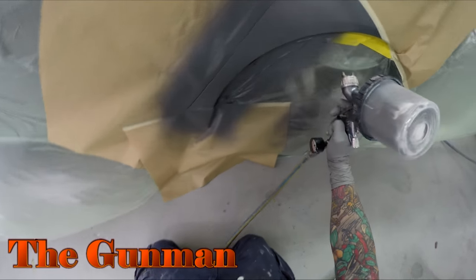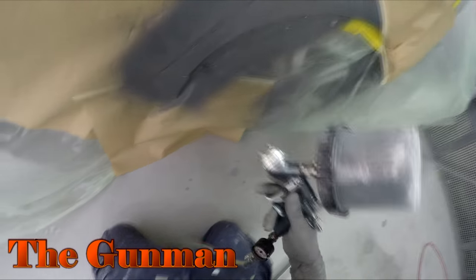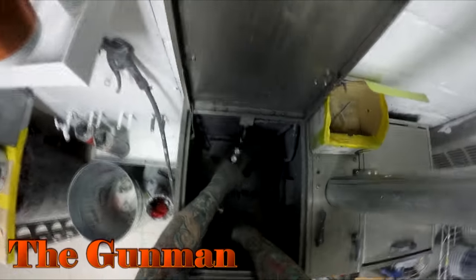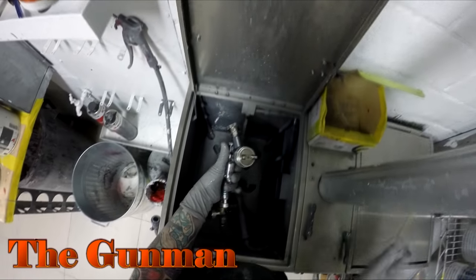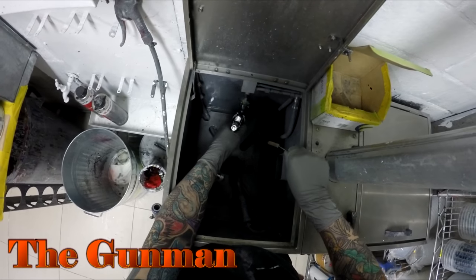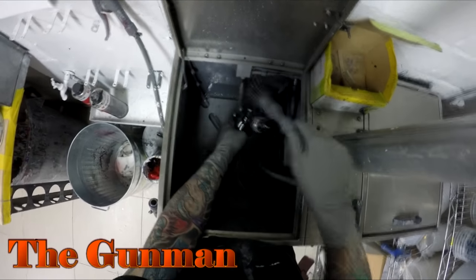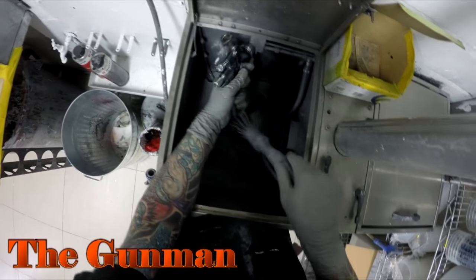For this job I ended up putting four coats on, obviously removing the flash-off times from the footage. You may have also noticed there was already a little bit of primer over the repaired area — the panel beater did his filler repair and then put a coat of etch primer out of an aerosol can just to fill any of his scratches and seal down the metal for adhesion. If there was any bare metal I would have got some wash primer and put a bit of that over it. Those wash primers and etch primers do have a little bit of corrosion protection, so you really are best off using them.